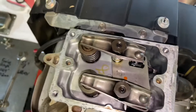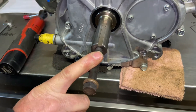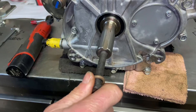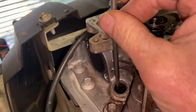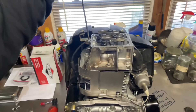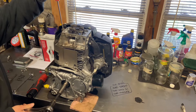Here are your valves, and we're going to have to get this up at top dead center. We put this crankshaft bolt in from the double pulley that was on the engine, tightened it up good — you can use an impact to put a little more tension on there, just make sure it's tight so we can turn over the engine. You are going to be turning over that engine counterclockwise. I'm going to put my skinny screwdriver in here — you can use a skinny screwdriver, just be careful.